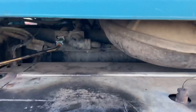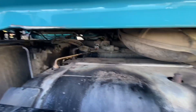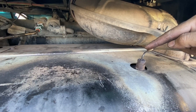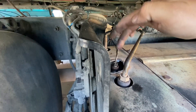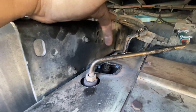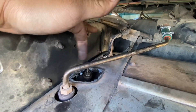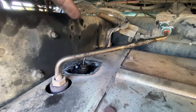You have your temp sensors — this is going to be your DOC inlet, DOC outlet, and this right back here is going to be your DPF outlet temp sensor. It's a pain in the butt to remove. We had to make the opening a little bigger so we could get a socket and start loosening things up. This is just a heat shield — I know it looks ugly. So anyway, we replaced that sensor.